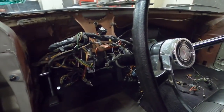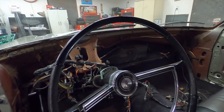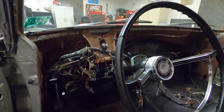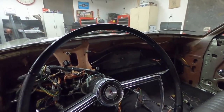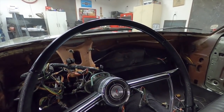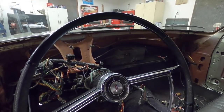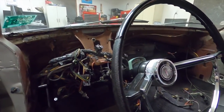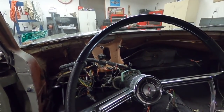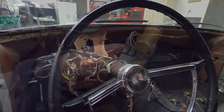I'll probably take the steering column out to paint it. I'll get the dash down, pull the steering column, and pull this wiring closer to when I need it - it's a good place to store it right here. When I go to put the dash in, the steering column will be out of the way. I assume when this car was rolling down the assembly line, the dash was installed before the steering column, because you've got to undo the steering column to get the dash in and out. The dash and steering column were probably installed before the body was attached to the frame - that's my educated guess from being in assembly plants.